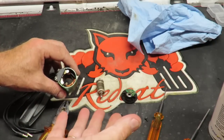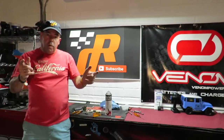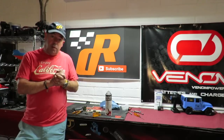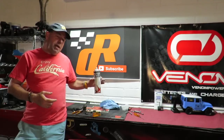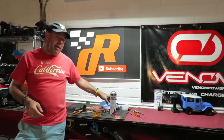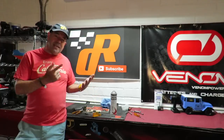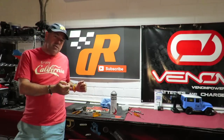My first thoughts were the inside of this thing was not going to be that interesting to look at, but I thought it might just be something that people would not see from day to day. So now you know what's on the inside of a brushless Castle sensored motor. Fingers crossed they're going to replace that one under warranty because that shaft breaking was not ideal. Overall, I highly rate Castle products. Look at that muck and grime build-up in there — it would not be a bad idea to take your brushless motor apart and give it a blast of this stuff once a month or every couple of months, just blast any dirt and grime out. Very simple to take apart — what, six screws in total? Use that Magnum Force or nitro cleaner, a bit of tissue paper. You've got property to protect — your $85 to $90 Castle brushless motor investment.